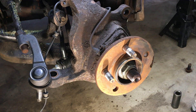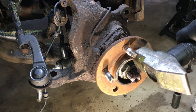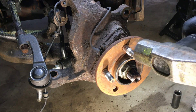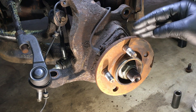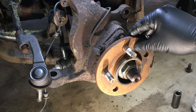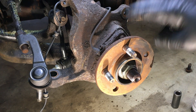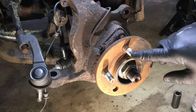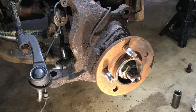There are a couple different options. The most basic tool you can have around is a small mini sledge like this, and you can simply tap them out. Now it does put undue stress on the flange itself, but this hub takes a lot of force with the weight of the vehicle, turns, and a lot of stuff, so it's actually pretty strong. You just have to watch that you're not cocking it — just a couple taps and it should go right through, like so, with safety glasses on.